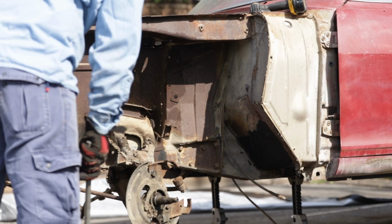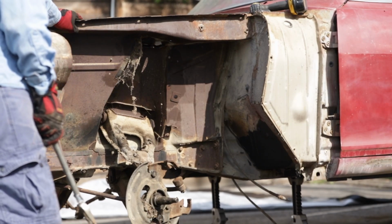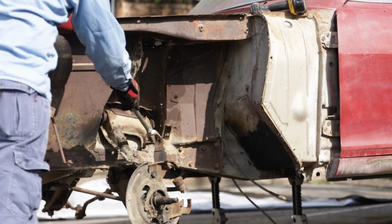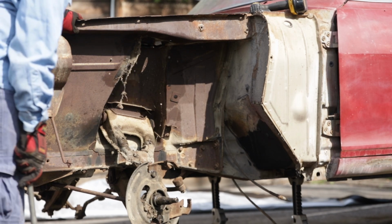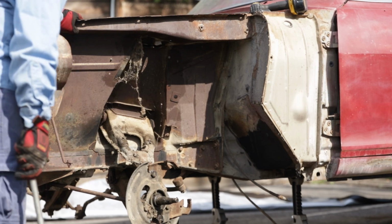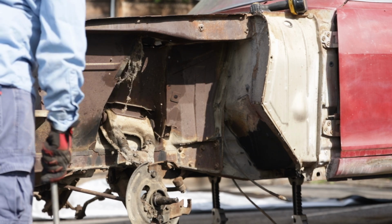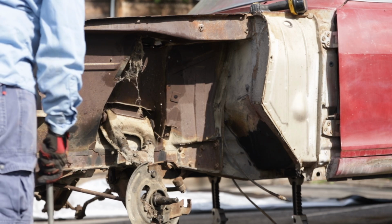That's what I was looking for. Okay. So basically, by undoing the cross shaft for the shock, I was able to get underneath it and pry it loose. And now, if I just undo the lower control arm and upper control arm, I should have all this stuff out.